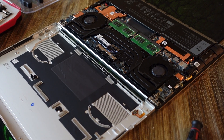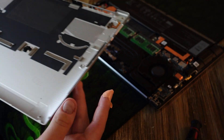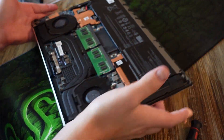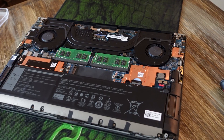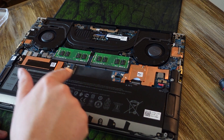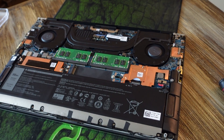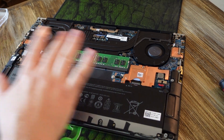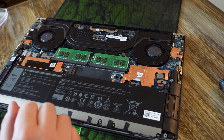We are back, bandaged and ready. Let's take the back panel and move it out of the way and take a look at what we have here on the XPS. Spinning it around to a more traditional view — we have the one SSD that's pre-installed, our RAM, an empty SSD slot, and the Wi-Fi card is over here under those heat sinks. You can see the cooling system, the battery, and the main motherboard. The CPU and GPU are up here with these heat pipes attached to them.